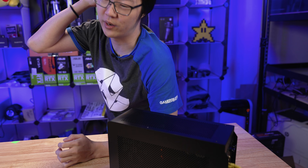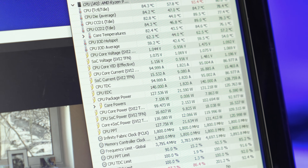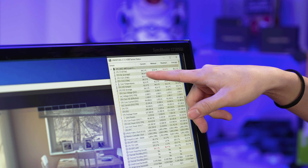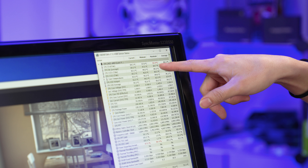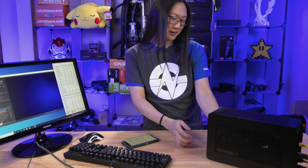It's a nice white noise, like a background white noise. So we're gonna let this run for a couple of minutes. All right guys, so we've been running for about a good five minutes or so now, and you can see we are getting some spikes that are kind of high, but we are not currently thermal throttling. Average is about 80 degrees. The spike high was 93 degrees. That's actually really impressive for being a 92 millimeter AIO in this tiny little box. I'm putting my hand against the sides here — it's like a little heater — and it is able to dissipate that heat on Cinebench. It's running stably.